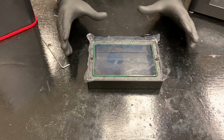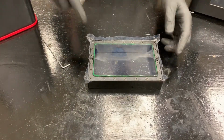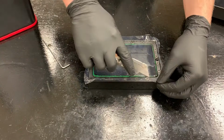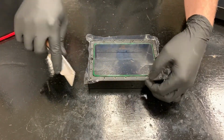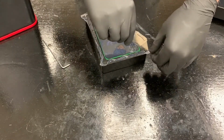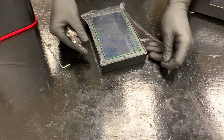All right, so now that we got this gasket all tightened down evenly, the next step is to trim up all of this loose material here. So we're just gonna use a utility knife. An X-Acto knife is good for this as well. And just practice good cutting technique here, everybody. Unleash your inner boy or girl scout, as I was actually about to cut into my finger.